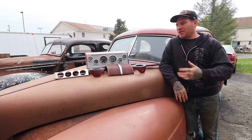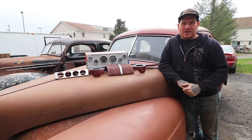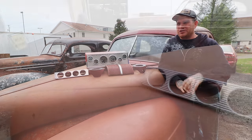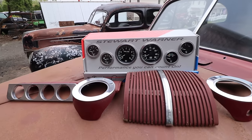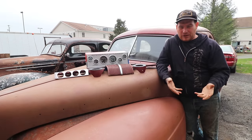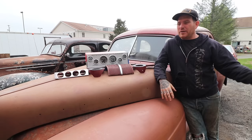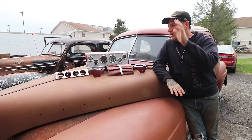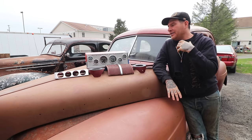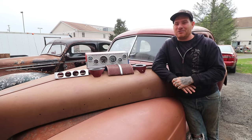One of the big things we needed to take care of was the gauges. We've already got pretty much all the wiring laid out in the car and done. The last thing we need to do as far as wiring goes is just the gauges. So naturally, I went for Stewart Warner gauges. On a lot of the other cars that we're doing that are more period-perfect, we are using true vintage 40s and 50s Stewart Warner gauges - very expensive to get them restored and put back in the car. This car, we have a little more freedom because it's more of a street rod. We can opt for some classic-looking, modern Stewart Warner gauges. So we chose the Stewart Warner Deluxe line of gauges - pretty much the standard. They've looked very similar for so many years. They will look right in the car, but it's a lot easier to hook up. We don't have to go through ten sets of gauges to get one good set. We have to do a little bit of modification to the dash on a 46 to 48, which we're going to show you. Hopefully by the end of this, we will get a complete set of beautiful Stewart Warner gauges in this car and be one step closer to having Dad's Daily ready for the road. So let's get started.